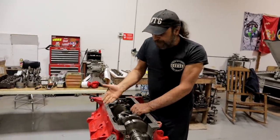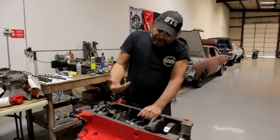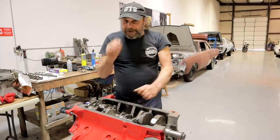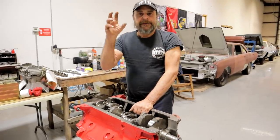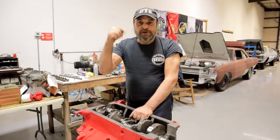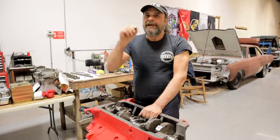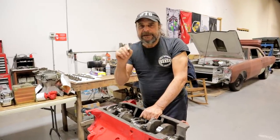Oil pickups are another concern. On big block Mopars, the oil pump is just hanging completely out of the way and the pickup tube has to run through the whole gamut. If you make changes or use a different style pickup, it may not have the clearance. I just had that recently with a Slant 6 where I modified the oil pickup tube, but it came so close to a connecting rod that the rod actually dug a little trough in the pickup tube. I measured it and thought I had enough clearance, but I didn't — there was just enough distortion when the engine was running for the rod to nick it.